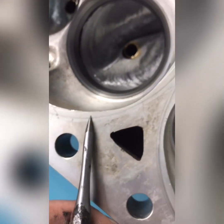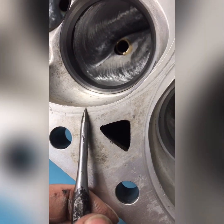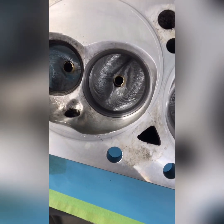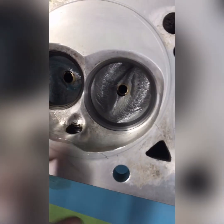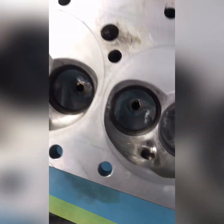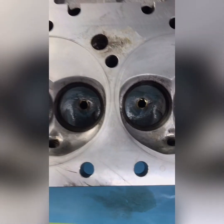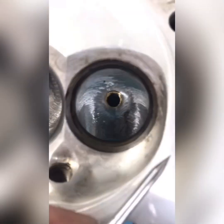All through right here is quite a bit bigger than the cylinder, and then right here it meets back again. So from here to here is bigger than the cylinder on the intake valve, which I don't think is horrible, just not ideal. Seeing this, these heads could actually even use a bigger bore - which I'm not doing - and I checked the valve clearance to the bore, which is good. These heads are all CNC'd but actually a little bit different, every one.